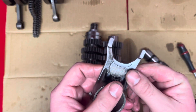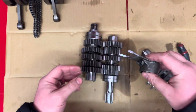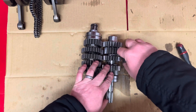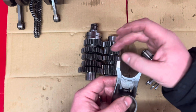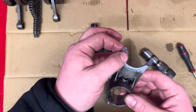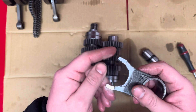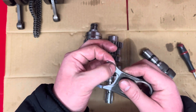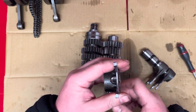And then on the fork — this is where the fork locates into your gear. You want to check there's no real marks in it, or chips, anything like that — gouges, burn marks, or worn away. But you can get a measurement — you can actually measure these to make sure they're the right thickness.